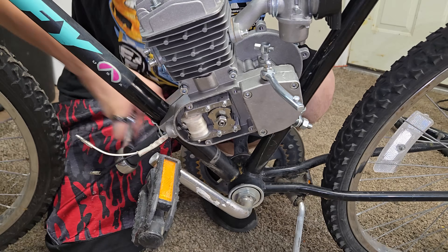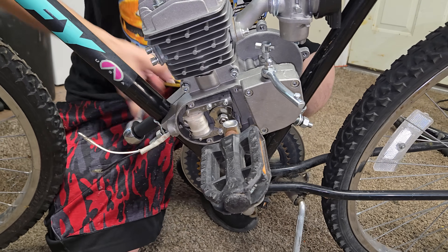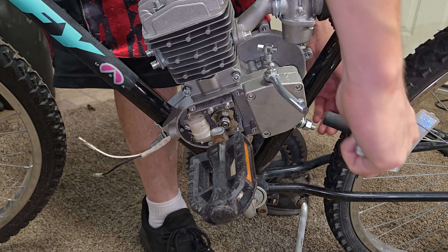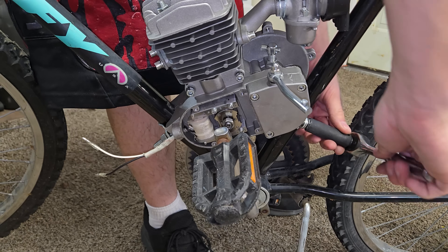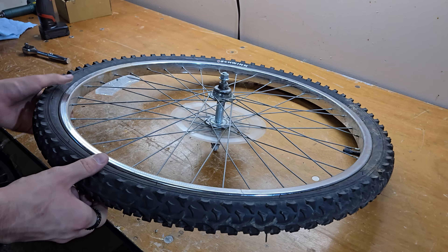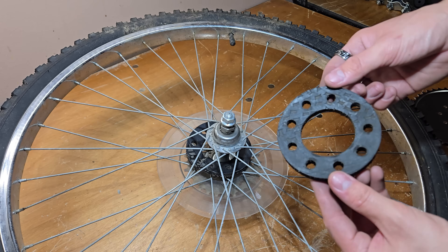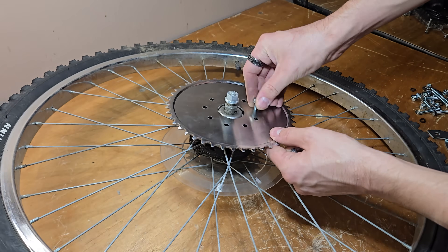Do not use rubber. You should tighten the bolts a lot more, but not too much, to prevent the engine from shifting to the left, which can actually loosen the chain. I think this is because the front tube is kind of too small — it's 1.25 inch. I would recommend 1.5 or 1.65 inch. Now we need to install the rag joint, which I absolutely hate. Definitely upgrade your wheels with six-bolt hubs eventually. I do not recommend putting above 5 to 10 horsepower on your rag joint — you'll break the spokes.